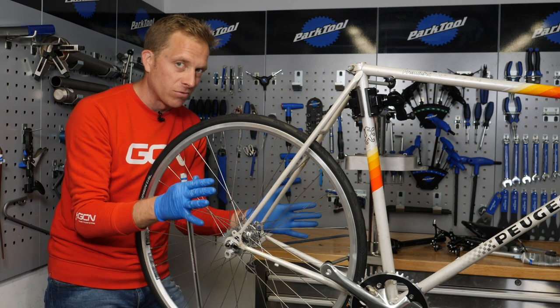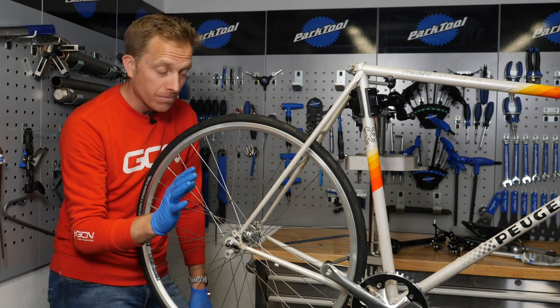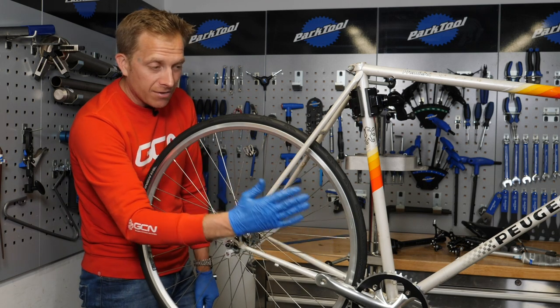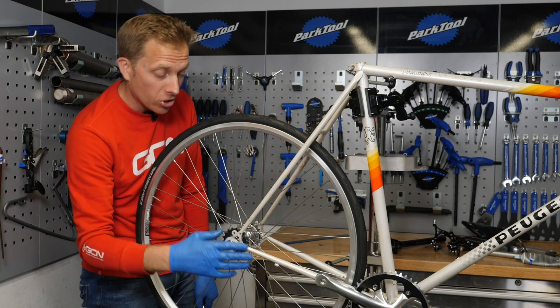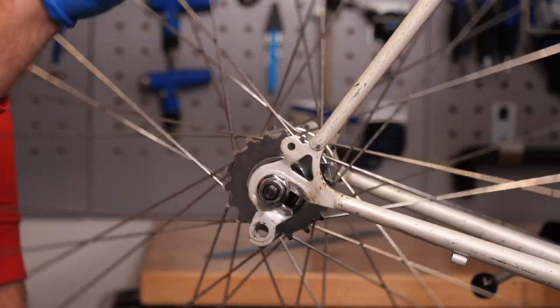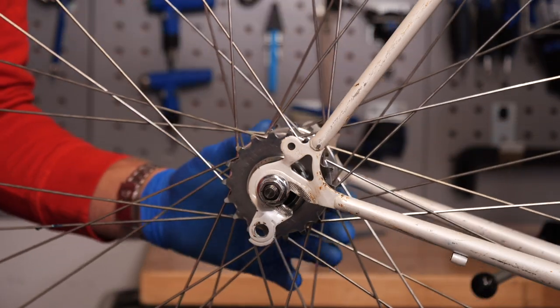As long as it's not too tight it's going to be running oh so smooth. Now, the reason I say too tight is because unless you are buying very, very top-end components, the chain rings and sprockets aren't necessarily that round. So inevitably there is a tight spot when you ride. In my case here, I haven't used top-end components, so there would be a tight spot — we are going to have a chain which has a slightly looser spot at one point than another, but we'll come on to that shortly.